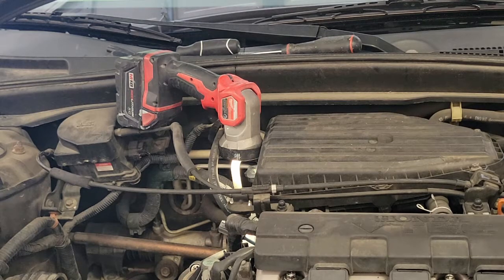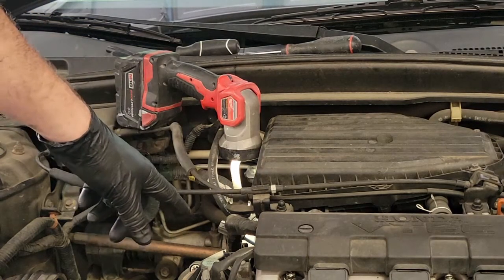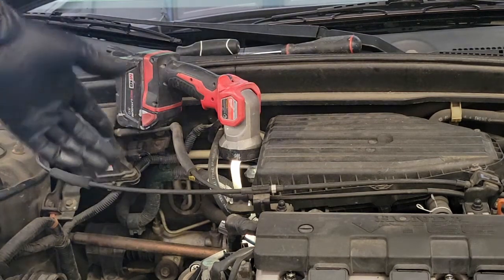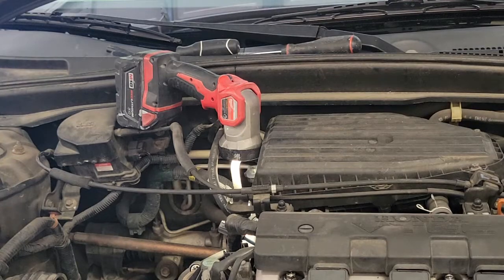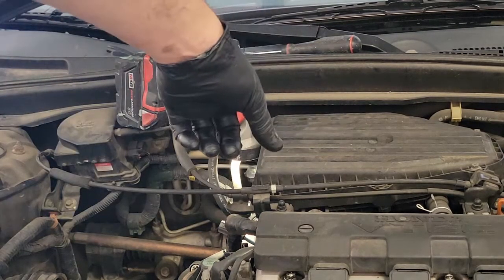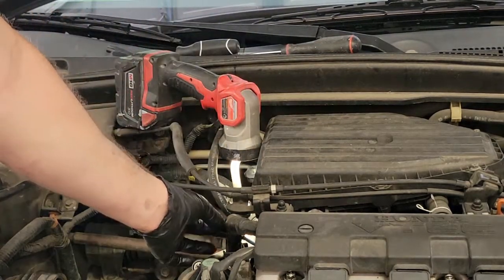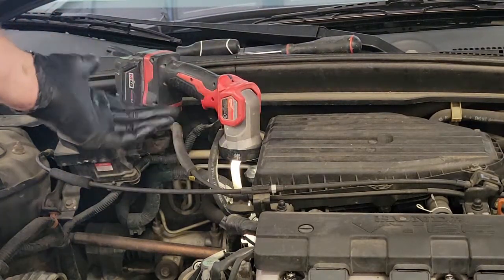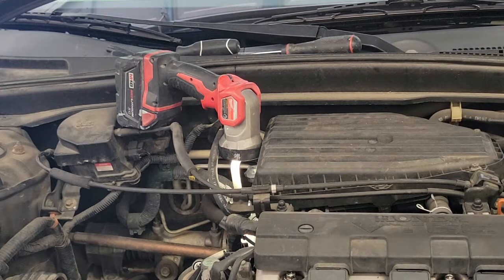Right now it's looking like a stuck valve, because I've got good continuity through the coil and the pressure switch is closed. So either the pressure switch is physically stuck closed and can't open, or the valve is just not opening. I'm going to take a jumper wire from the battery and go straight to the terminal going to the solenoid and see if I can hear it move. If it's physically stuck, applying 12 volts to it won't do anything, but I may be able to hear it move.